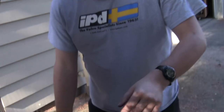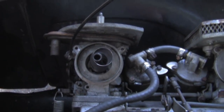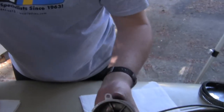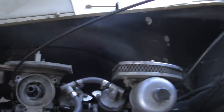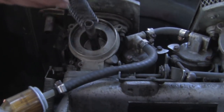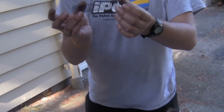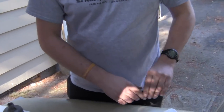We've got the three screws out of the dome. Now the moment of truth — we'll lift this up kind of slowly. Here are the different components of the carburetor. First, we'll look inside the dome — it's a little bit dirty but not too bad. Here's the spring which pushes back down. That spring's probably seen some better days; I should probably replace this, but we'll keep going for now.